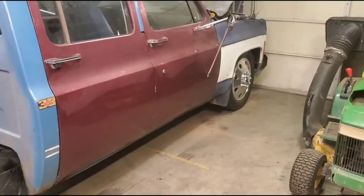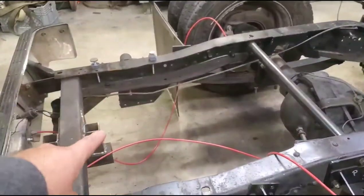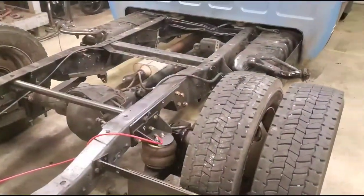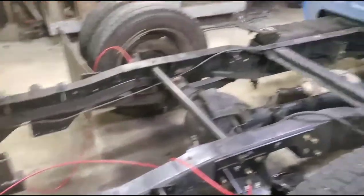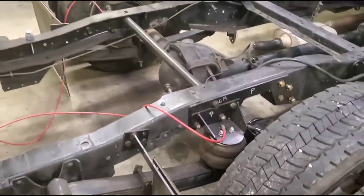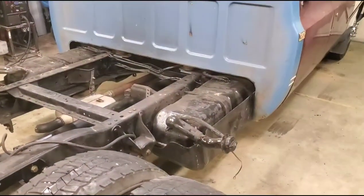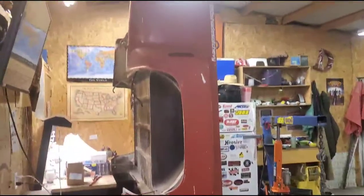The front has already been lowered. Next step is I want to put onboard air on this truck — I have an air tank that's going to go in the back, making all my own crossmembers. I'm going to use a Firestone air compressor because I'm too cheap to buy a brand new ViAir, but it'll do just fine. The only things running off the air tank will be train horns up front and an air controller to the cab for the helper bags — no full air ride right now. I'll also have a quick connect for airing up tires or blowing out the cab. Once the air tank and compressor are mounted, we can put the giant bed on and pull it out in the sunlight.